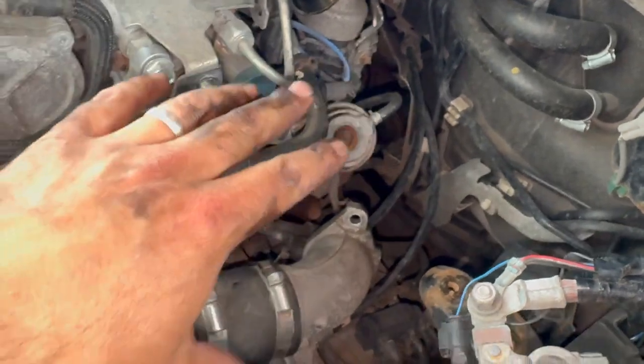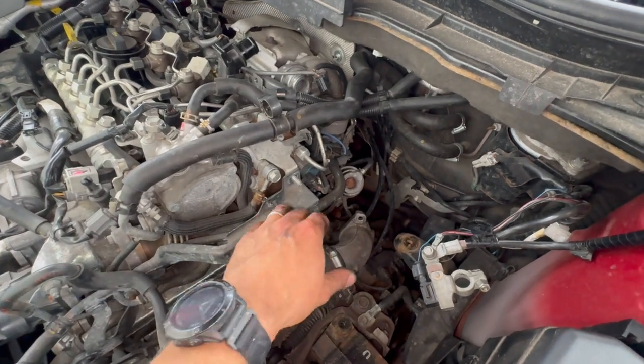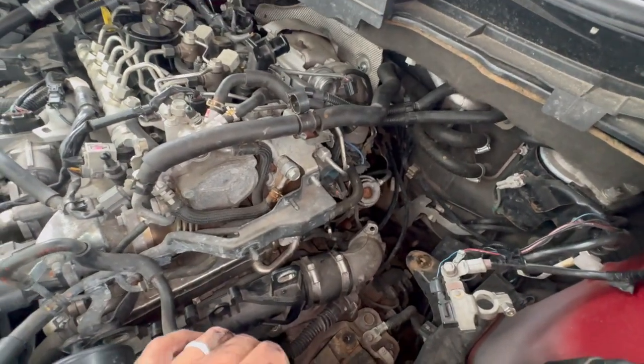As you can see, if you've got that fault code and you're a little bit unsure and you're thinking about condemning the turbo, if you just take that pipe off and check, it's relatively easy to confirm that's the fault and be 100% sure. Obviously it is a fairly big job with this one.